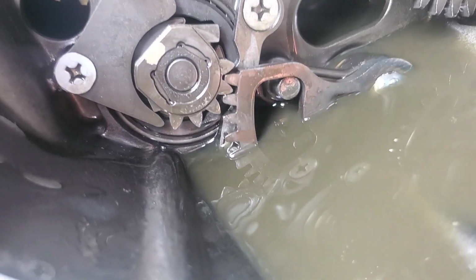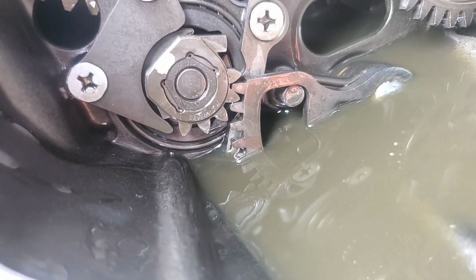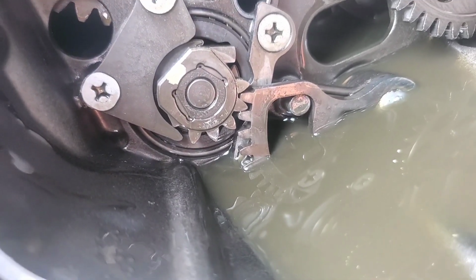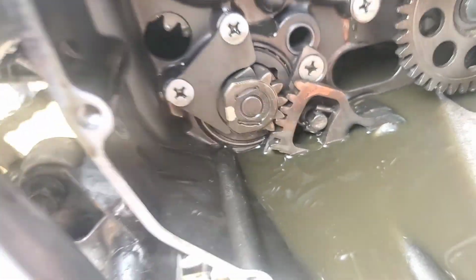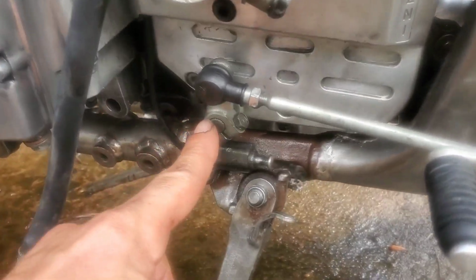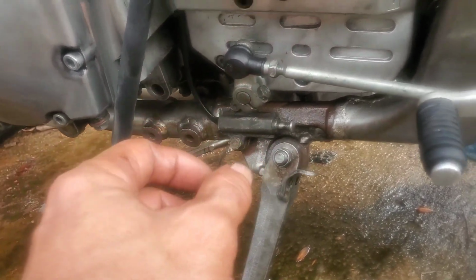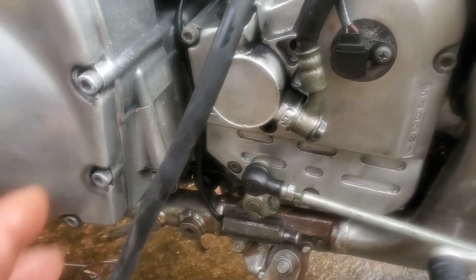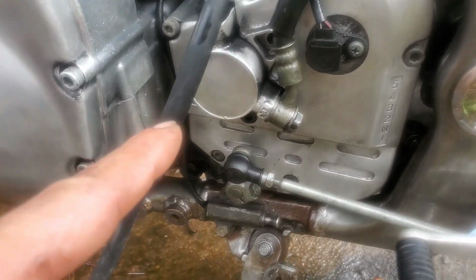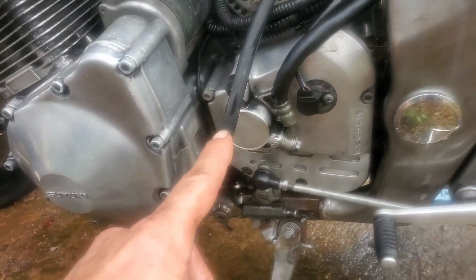I just need to pull that cover back off, pull a clip, slide this in, and engage it another 1 or 2 teeth over, put it in the middle, and that's it. I should have all gears. This side is pretty self-explanatory. You got to pull that off first, so loosening that guy, it's a 10 millimeter, and then wiggle it off. And then number 5s on all of these, pull them loose and wiggle that off gently. Don't lose your clutch rod or the ball bearing that's behind it. Keep those in the doohickey if you can.